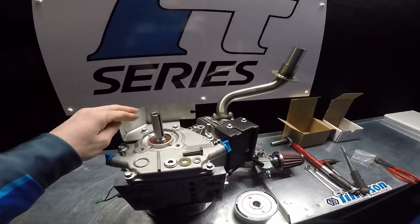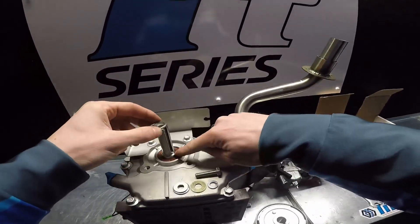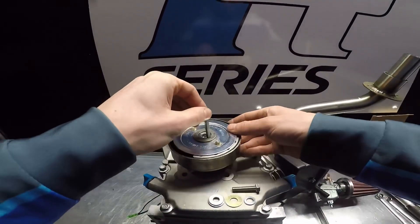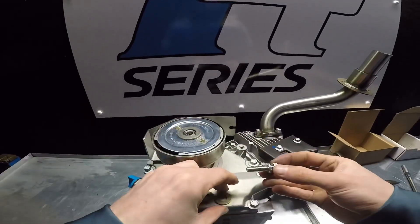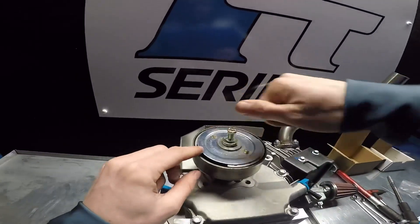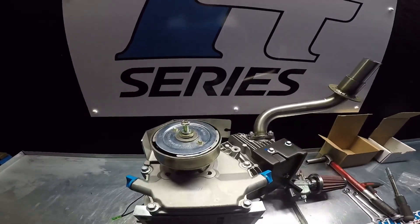I have the chain guard tight now and I'm going to put on the clutch next. Start by putting on the ring washer first with the taper to the inside so it will mate up with the taper on the crankshaft. Then slide on the clutch matching up the slots, then slide in the woodruff key. With the M8 bolt, put on the spring washer first, then the penny washer, then the stepped washer with the step to the inside, and tighten up this bolt to 30 Newton meters. You can use a plug stop to stop the crank rotating while you tighten it up.